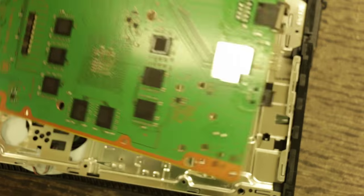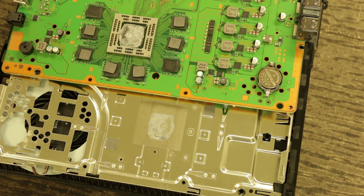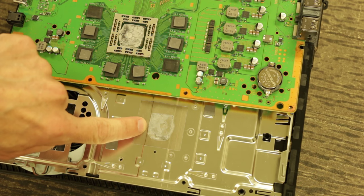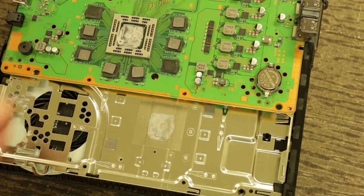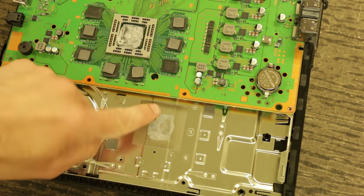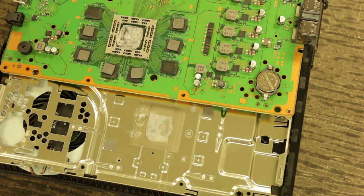This is the motherboard — I've taken it out already to make it easier. On the underside of the motherboard you can see where the thermal paste is located. We've got thermal paste on the chip and thermal paste on the heat sink. You can see this thermal paste is kind of crusty and crumbly — really not the best thermal paste. You can see what most of them look like when we get them in; there are a lot that are even more crumbly than this, so it's not the best fresh thermal paste that they put in these things.